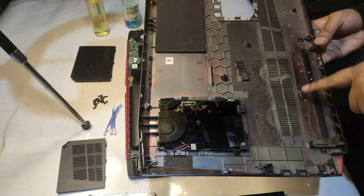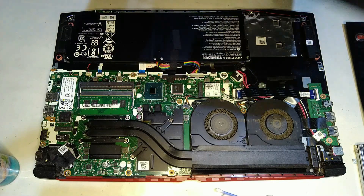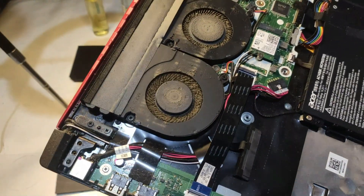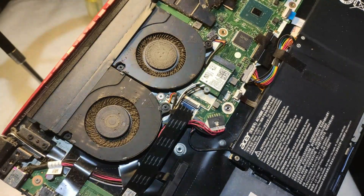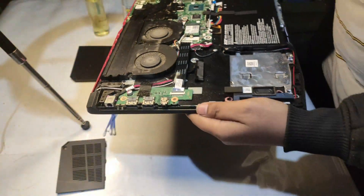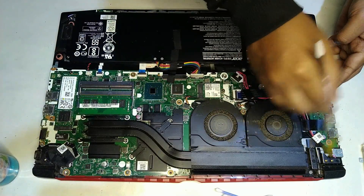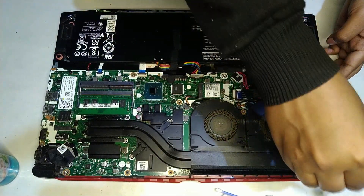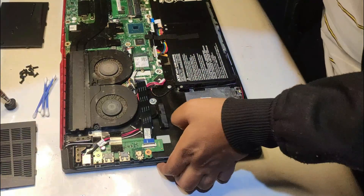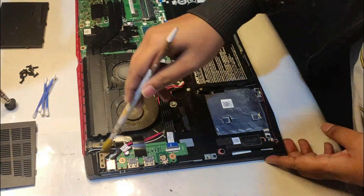Your laptop will overheat because of dust clogging, dried-up thermal paste, poor quality thermal paste, or insufficient vents for airflow. Most of the time it's just dust clogged into the heatsink fins and dried thermal paste. This is my personal laptop, the Helios 300 2018. I've been using it for two and a half years, last cleaned inside in late March 2020, almost a year ago. It now throttles immediately in any CPU-intensive benchmark, hitting 95°C and unable to maintain 3 GHz on all four cores. At the end of the video I'll do a CineBench run to show before and after differences. This process is the same for almost all traditional notebooks.